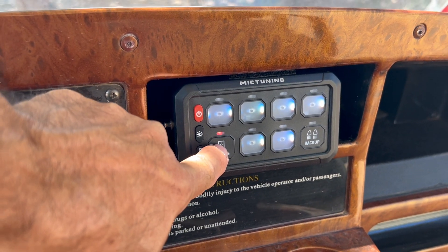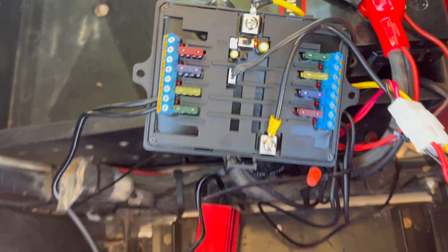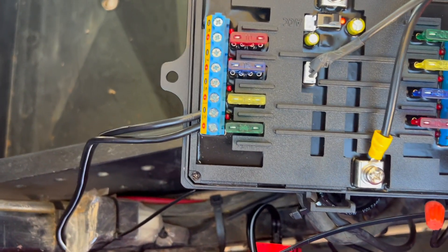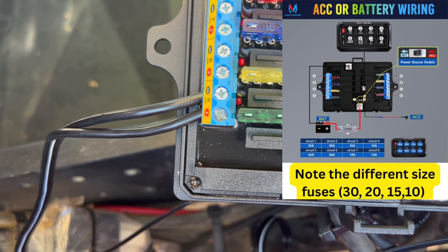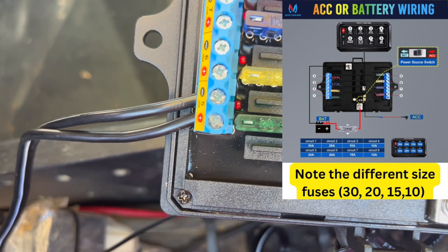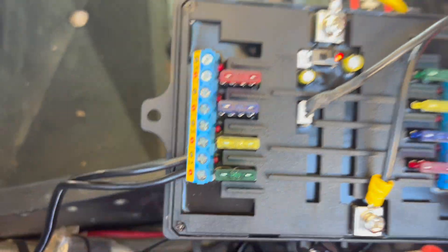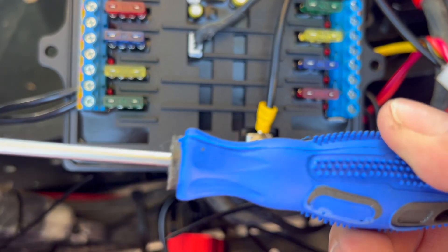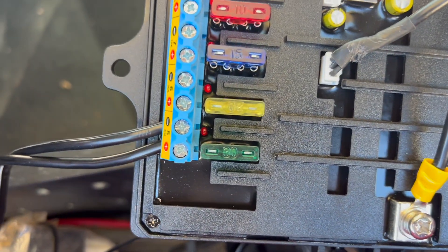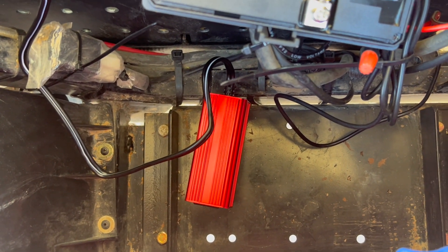You can change the colors of the switches also, and you can turn it off. I'm wiring my first accessory. I did take the fuse block off the side — I'm happy I'm using Velcro so I can see it better. I chose this switch right here. All I did was positive and negative: unscrewed it, slid the positive in, screwed it back down, then unscrewed the negative, slid the negative wire in, screwed it back down. The kit provides a perfect little screwdriver — it fits the Phillips head well and has a nice grip. That's that. I'll put the cover back on and mount it. That will be my 110 inverter.